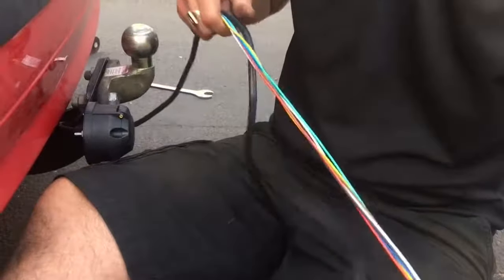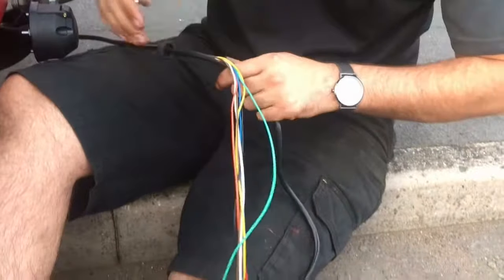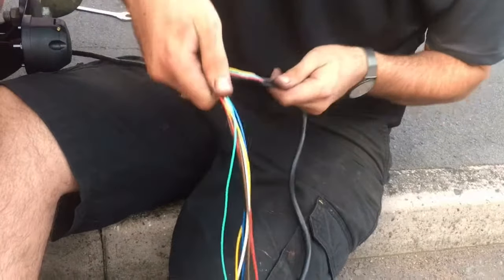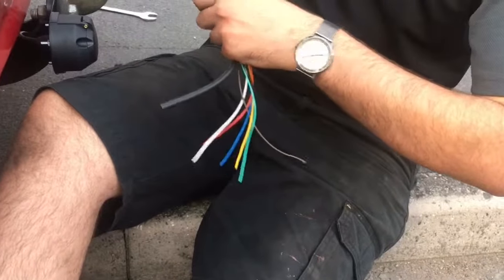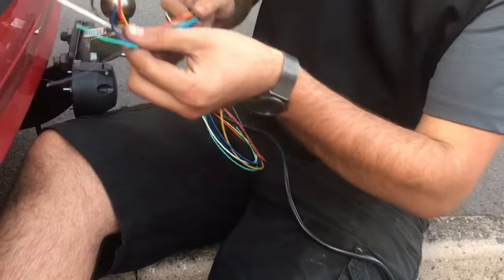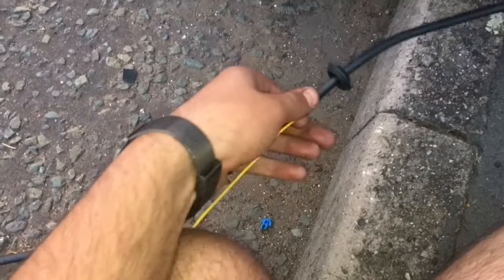The wiring isn't long enough to reach both sides, so what I've done is scored down the main wire. Once it's been scored with the knife, we can separate it like that. I'm going to run this to the driver's side and find the corresponding wire for the left hand indicator, then run that across the inside as well. I've hand-plucked these two wires - the yellow one is the left hand indicator and the black one is the rear tail light.